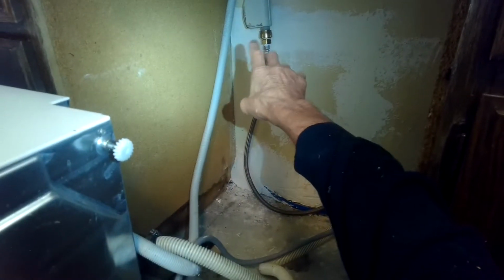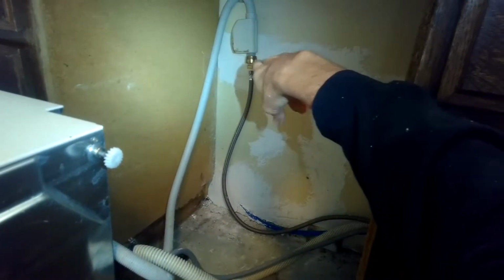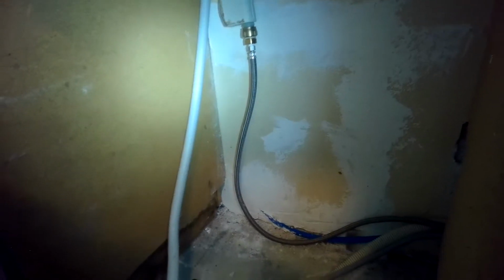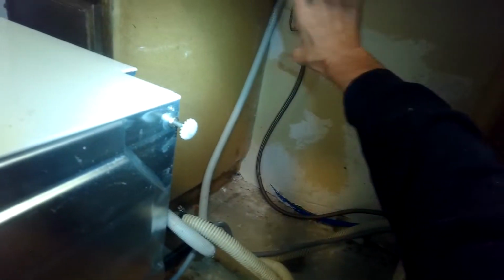Just so you guys know, for the MIELE, it's good to have the fill valve up a little bit higher, as we see in this case. You usually have to replace these pretty often for customers. For us, though, this one's been in here for years and years and hasn't failed. So when you think about installing yours, I think they recommend actually that it's on the horizontal plane and that it's up a little bit higher like this.